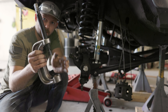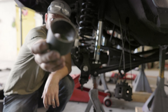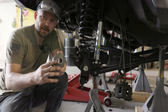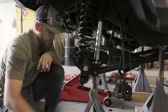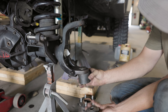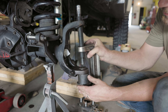For the bottom one, we're going to use just the push part of the ball joint press to push down on the top of the lower ball joint. We're going to use a little bit smaller collar, and then we're just going to use a little cap with a hole in the bottom so that the ball joint stud can actually push straight through. Getting this guy set up, this is the collar that's going to go there. This plate here with the hole on the bottom, so that the stud can pass through, is going to go like that. Fish this whole thing up through.